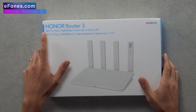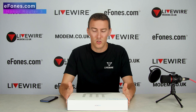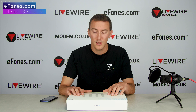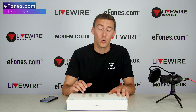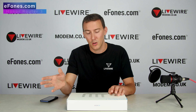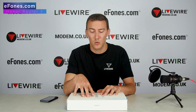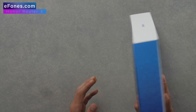So looking at the box, the big deal here is Wi-Fi 6 — the Wi-Fi speeds versus the price bracket these fall into. It's a very affordable, very fast router. It's not a mobile broadband router; this is a router you would plug into your home broadband router via an Ethernet cable on the WAN port, and then it distributes your Wi-Fi. If you have a mobile broadband router, you can plug this into the WAN port, turn off the SSID broadcast on your mobile broadband router, and use this to distribute the Wi-Fi network — but it all depends on your home environment.